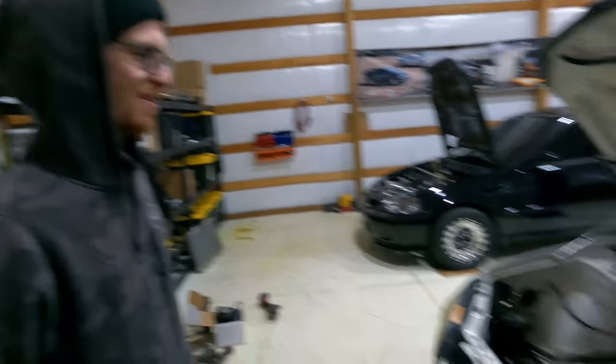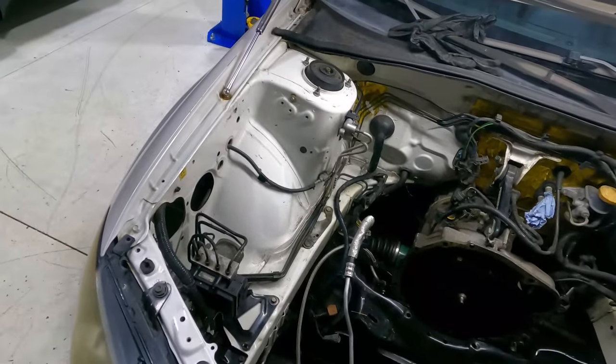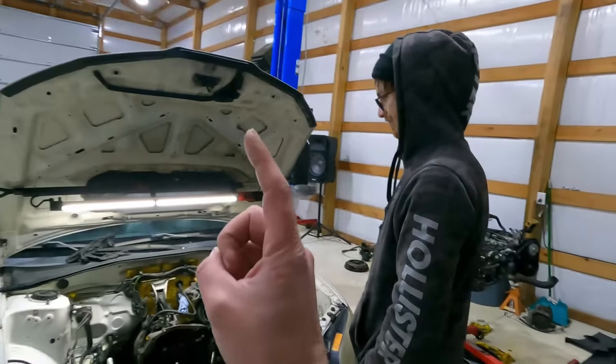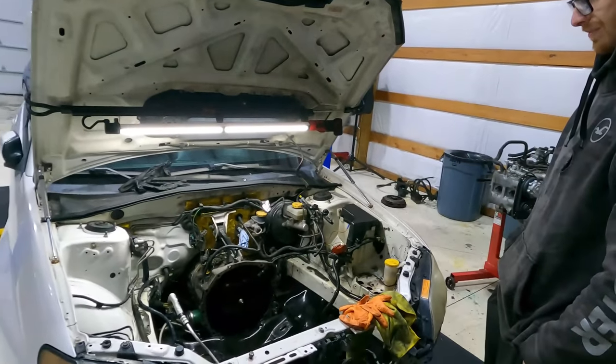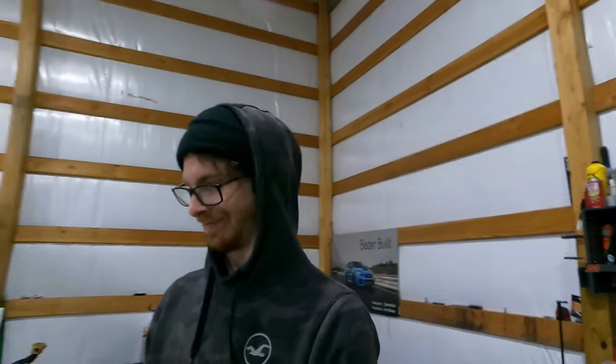You're going to show them your goods? It's not done yet but it's all right. She's got some miles — she's not perfect, she's not a show car, but she's looking good. Just got to finish up the firewall. We were going to use an FP Black on this baby girl, but BCP reached out to us and we're going to test their X500R on this — they're being nice enough to send that out to us. Justin's being nice enough to use his car and his motor so we can throw a car together. It's supposed to make 600 wheels. That's usually 510-520 region in our Mustang. We have to step up our game — we need injectors, need to upgrade the fuel system. We got the fuel system, just need bigger injectors.